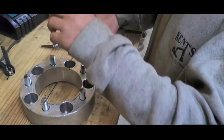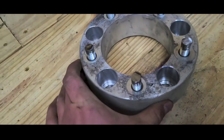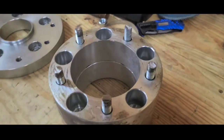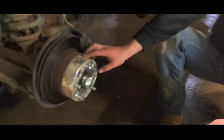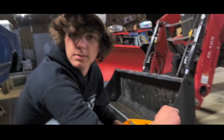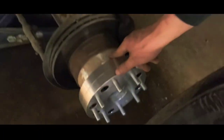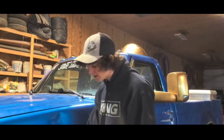The case is over here making sure the threads are all good on the spacers. Just finished up cutting the last one. We've got two of them done, so let's go get the front ones on while he's fixing the other spacers. We've got all the cut spacers on, bolted all those boys on, and now we've got all our adapters laid out and just have to bolt them up. So we've got a 2-inch spacer and then an adapter — that's 4 inches. I couldn't turn with 32s with 4-inch spacers, so I can't see how much turning we're going to have with a 33 with 4-inch spacers.